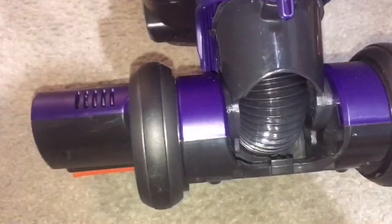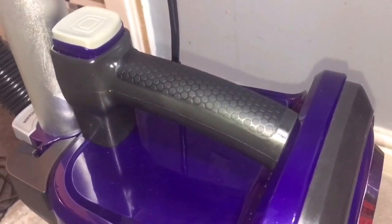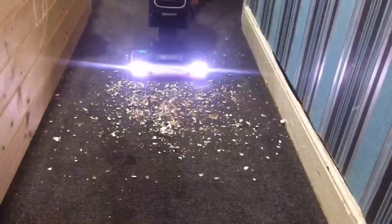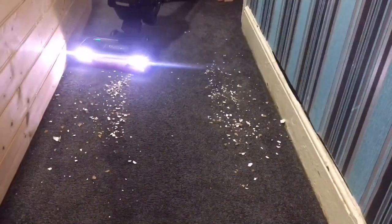It has some nice finishing touches, as you can see, such as the rubber coated wheels, carry handle, and the main handle. The suction of this vacuum is very good at the hose. However, because of the dual clean design allowing for larger debris to get sucked in, this means that suction will leak from the orange roller, resulting in less suction being focused inside of the carpet and more suction leaking at the front of the vacuum.